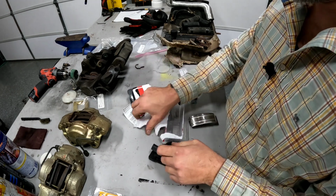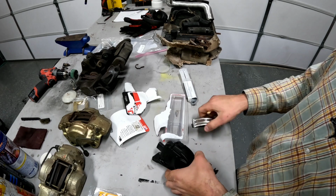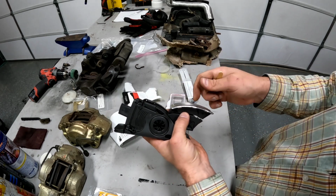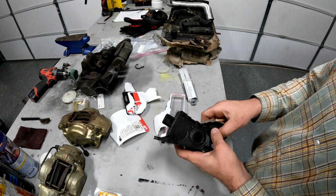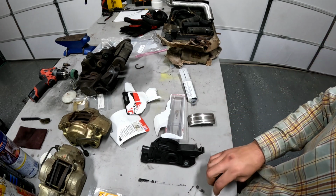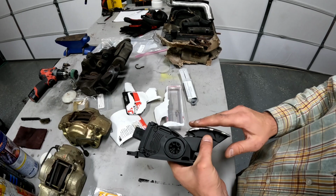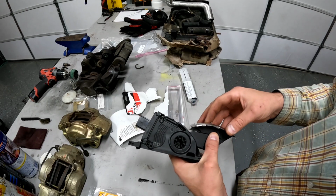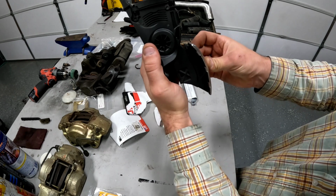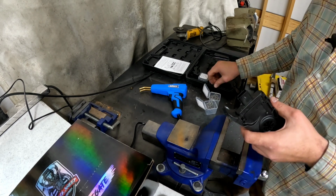And I've got some JB Weld plastic welder here, and what I'm going to do is coat this in plastic welder. It sets at about 15 minutes, cures in 30. And then once that's holding itself, I've got a plastic welder, and I'm going to use some plastic welder staples to reinforce the side. And I'm hoping that since this glue joint is supported fully when you press it, that's going to be strong enough.